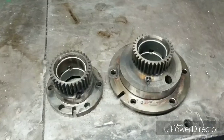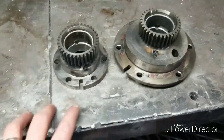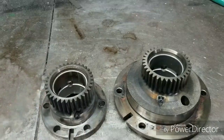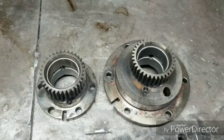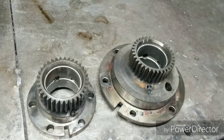Kyle Mohan here, we're going to do a little rotary knowledge — rotary tech on these stationary gears. Identifying stationary gears: if they've got a set screw in the side or they have multi-window bearings, you're probably looking at one of your later model or modified stationary gears. Prior to 93 to 95 you really didn't see multi-window gears unless they were in racing applications.